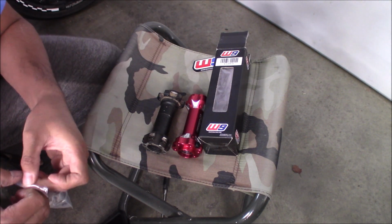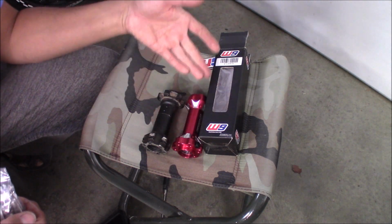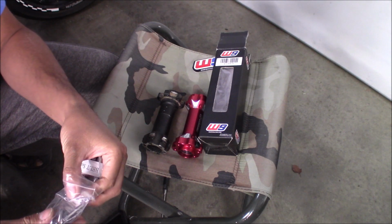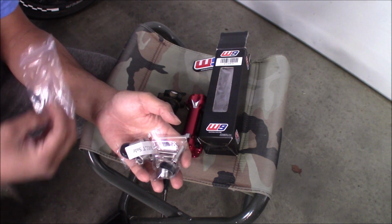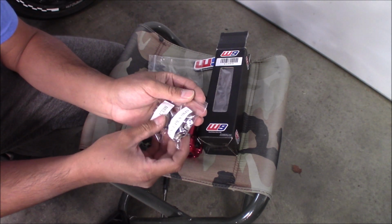All right, like I grenaded a bearing before. Okay, so not only do you get a stronger jackshaft, but you get much higher quality bearings. Okay, guys. For stock power levels, the Sur Ron bearings are fine, all right, guys. But if you're running like a high performance setup, I don't recommend you use the stock bearings.